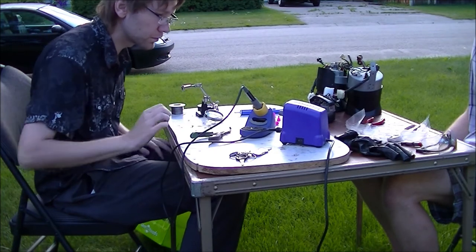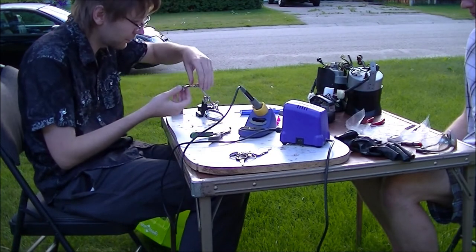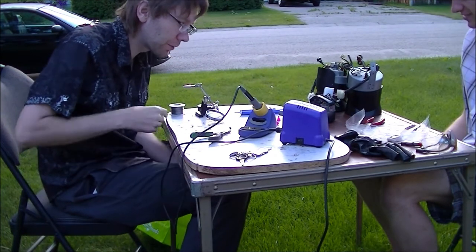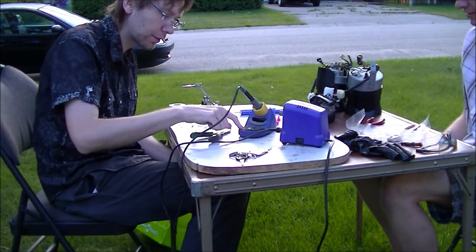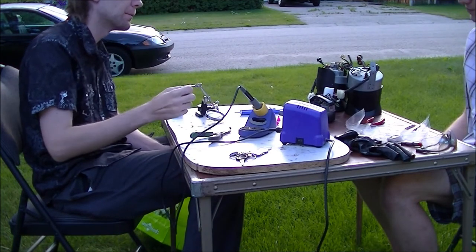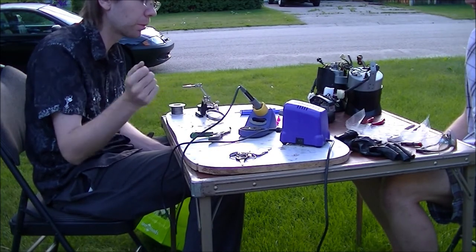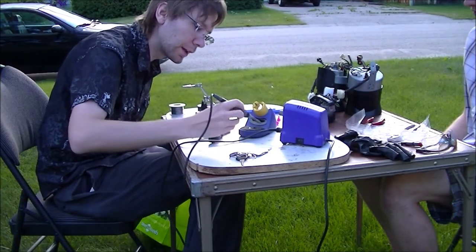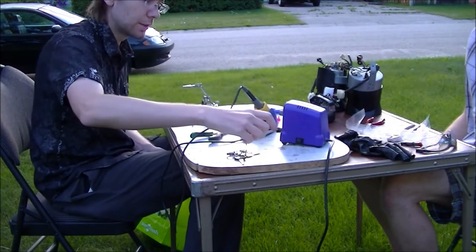A sponge for wiping it. Yeah, that's a good idea. Otherwise, it's a wet paper towel. But all right, you should just use this board. It helps because it's wet, it causes the solder that touches it to cool and solidify instantly, and so then it sticks to the sponge or to the paper towel. You can do it with a wet paper towel. And then when you pull it off, the glob sort of goes with it. That's good. So it makes it way easier to get the glob of solder off the top of the iron, because on ours, it just kind of smeared it around.